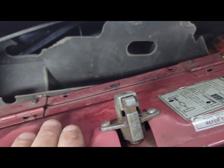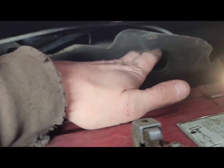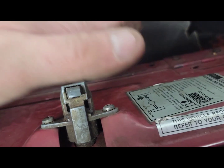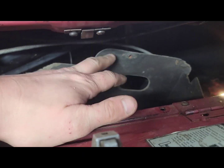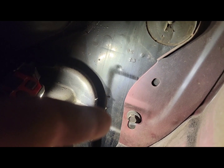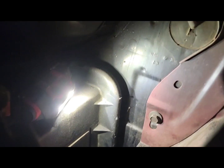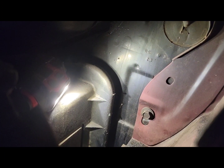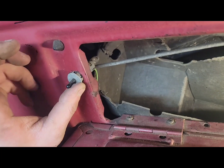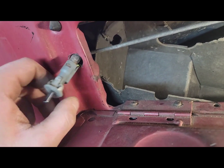Okay, so if you take your dash glove box down, then remove the screws holding it, and right here at the bottom it's holding your actual dash glove box. You'll come in through your glove box. That bolt right there is a 1/2-inch. You need to take it out as well. So I'll take this bolt out now. Okay, so to get this disconnected, you pull it through.